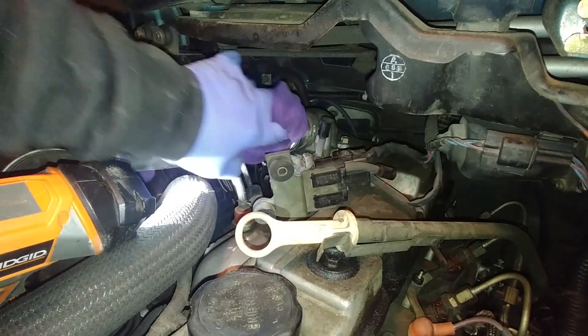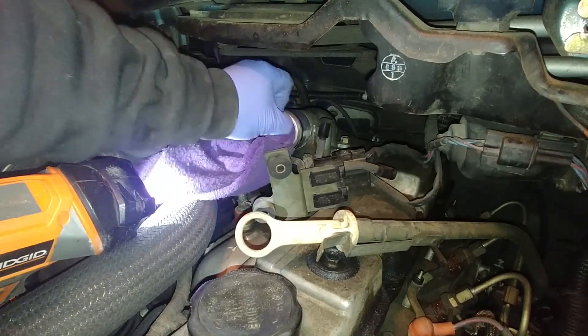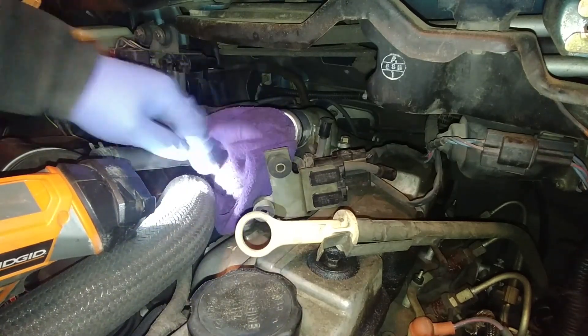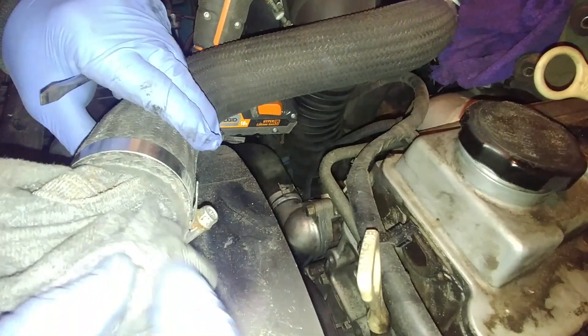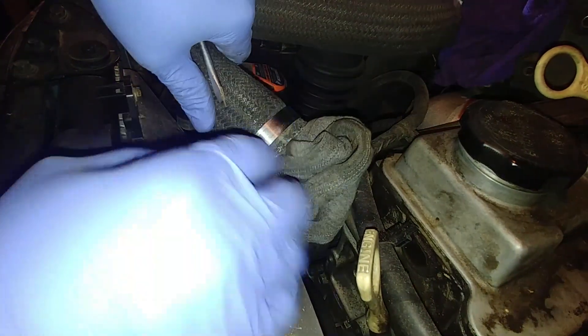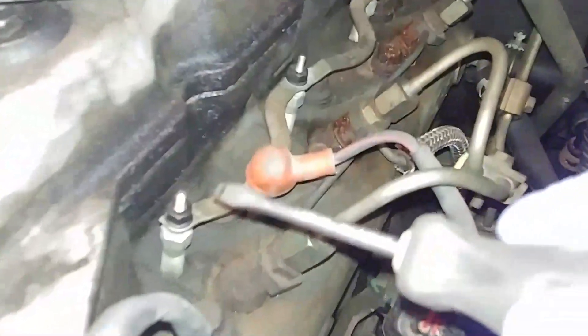Because our vehicle will need to stay overnight, make sure no mice or any rodents will get into the pipes. Just put a rag there like that, and the same thing on the other end, because they might get into the intercooler.